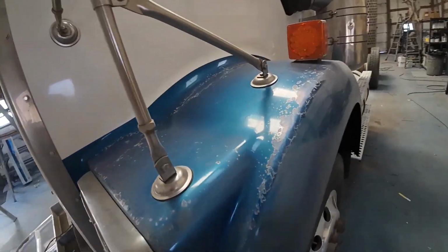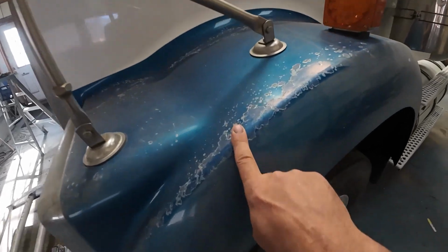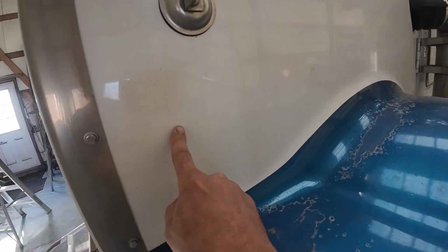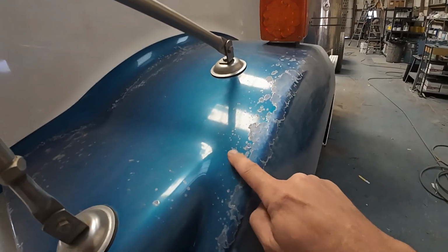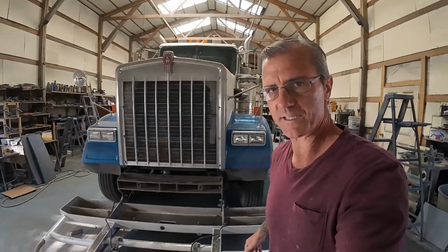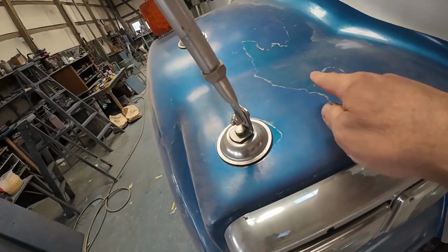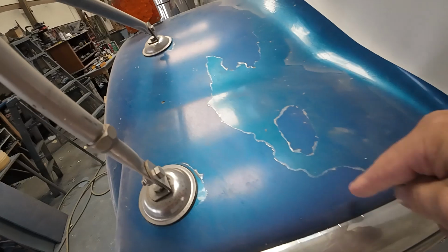You know, this is a 2005, so 19-year-old truck, and that's what it looks like after 19 years. And that's what the single stage looks like after 19 years. From the factory, this is single stage Imron. This is base clear, and you can see. Over and over and over again, you get to see this on my channel, and I've seen it for decades. I'm already well aware of it. And here's this side, just coming out. In fact, all this is base coat. You see, it almost has no clear left on it.